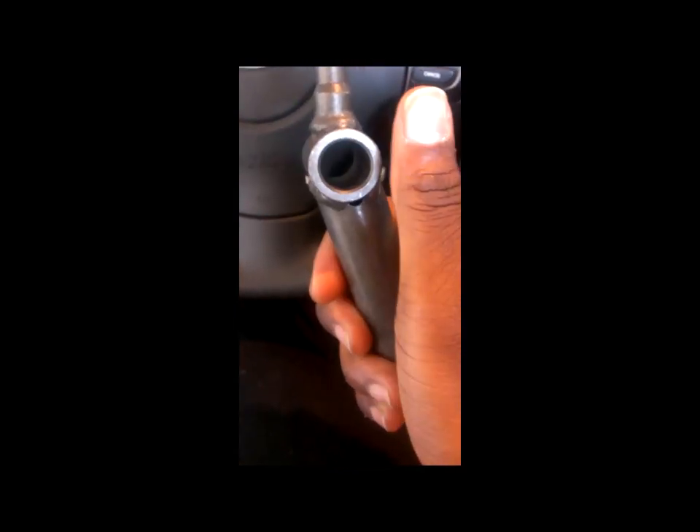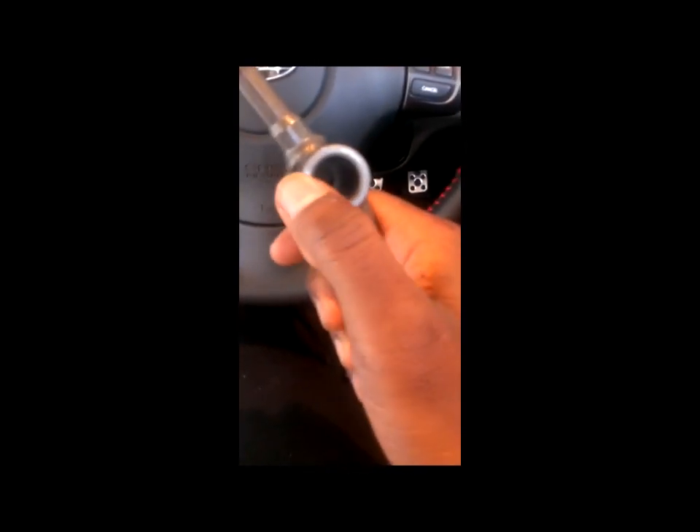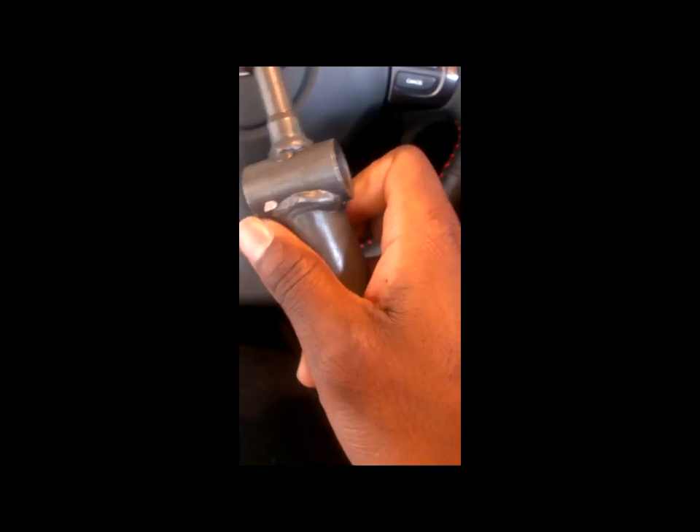That outer casing is like another rubber mounting — it's not solid all the way through, just two end caps on either side. Knowing this will prevent you from tearing up the outer hard plastic shell like I did. If you take a set of pliers and just stick it in straight and pry it out, it'll just pop out with some jiggling. Then you pop the outer casing into the new short shifter, the center piece pops through, you bolt it on just like before, and from there it's just reverse engineering — putting everything back together.